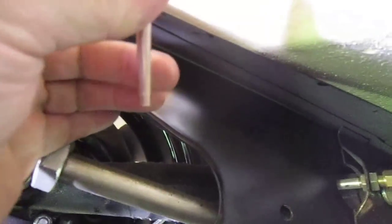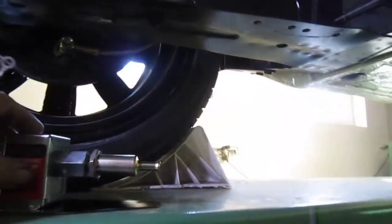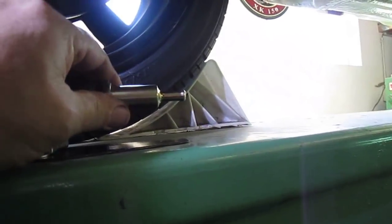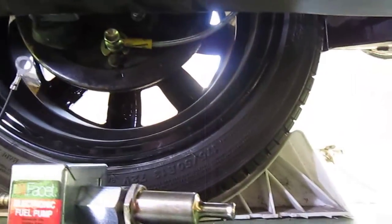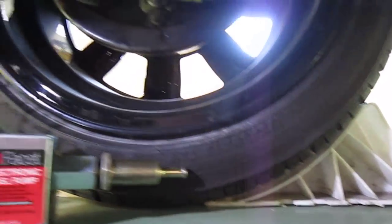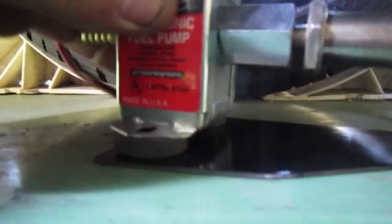So we put a rubber hose on this now, which goes into this side. You can see this is the flow. It goes onto this side, and then this is a pre-filter before it goes into the carburetors. Where it comes out through here, I've got the normal SPI one, which has 3 holes in it, and we put one to this, so it flows directly underneath, so it's basically gravity fed. The second one will be the vent from the tank, so that's one job that's going in. This will sit on these mounts I made up, so it's rubber mounted and not vibrating. And obviously we will have to change the wiring a little bit.